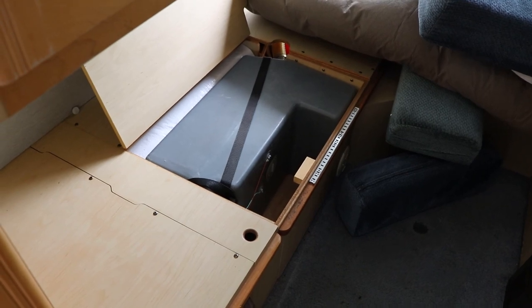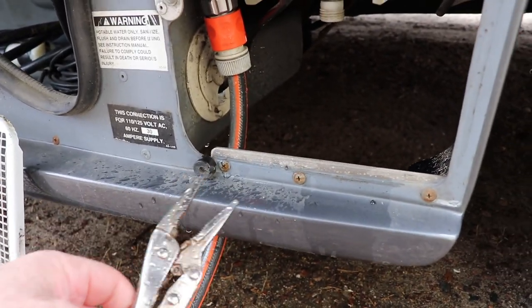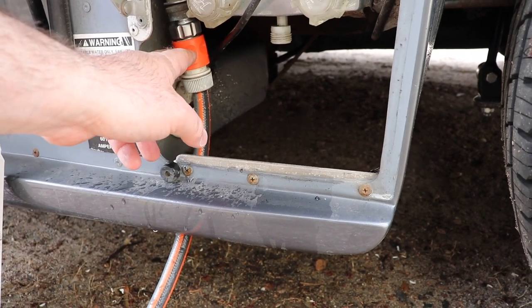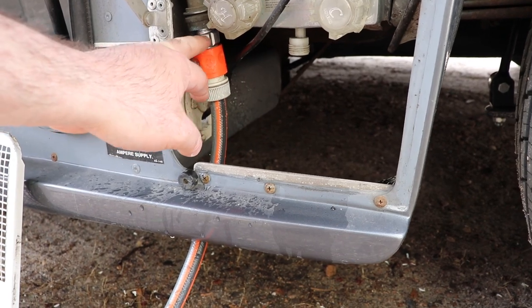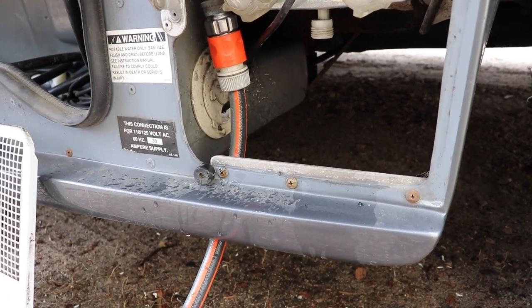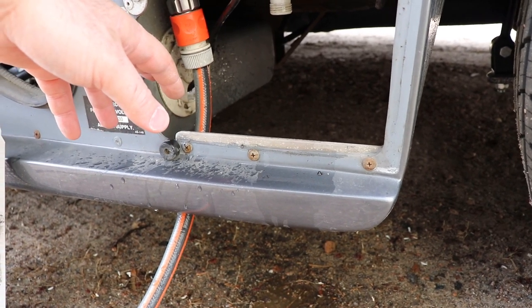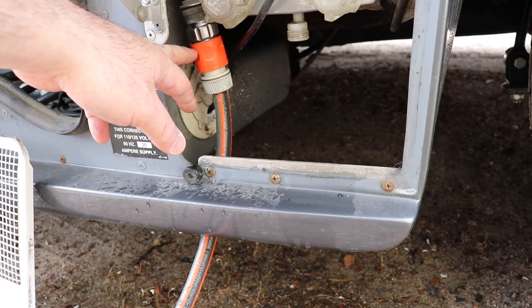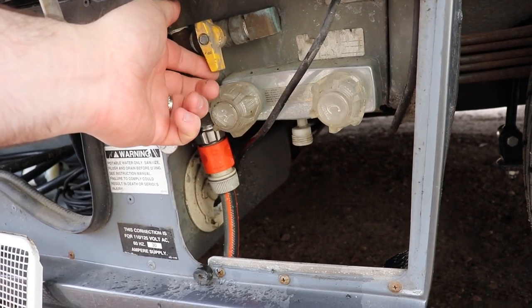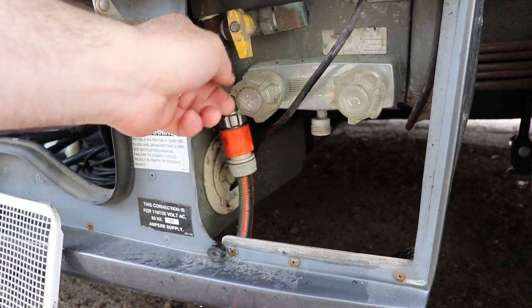I'm going to get the water hooked up outside and start filling the tanks. I've got the water hooked up to the city connection. You'll need some vise grips so you can hold this piece up here while you turn that on by hand. You need a new O-ring — it's not really feasible to be taking stuff on and off manually very often, so that's why I use the metal Gardena connector. It would be good to put a cap over that connector as well. As soon as you do that, your water is going to start working throughout the vehicle — it's pressurized. When we're running the bleach through the van we'll have to disconnect this, otherwise you'll be fooling yourself as to where the water is coming from.